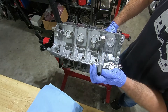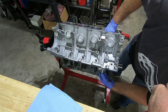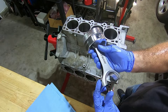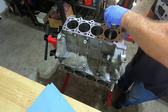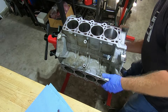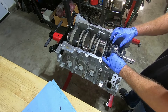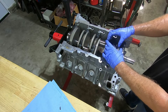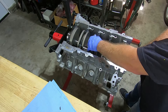Now put our cap on there. We're going to go serial number to serial number. I got five here and I'm going to drop this down in there nice and slow. Now I'll put the cap on — serial number to serial number. I just hand tightened these, barely snugged them down, and there is no rod play. These rods should be able to go back and forth slightly and there is nothing there. I probably can't turn the crank — yeah, can't turn the crank over.